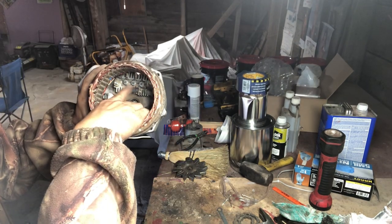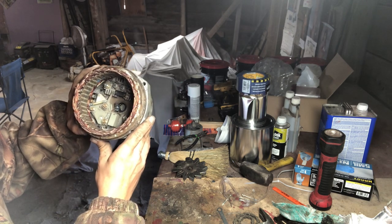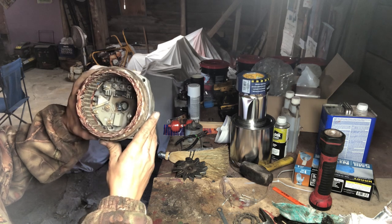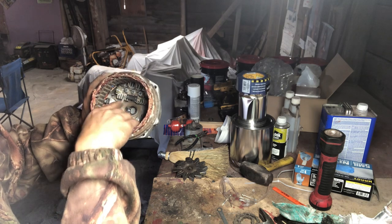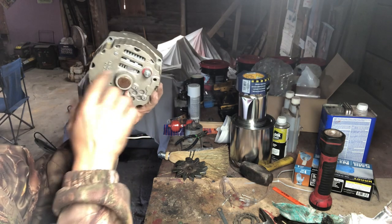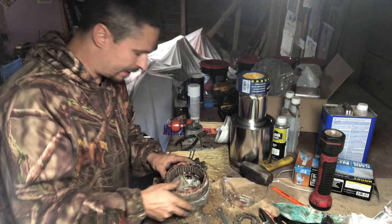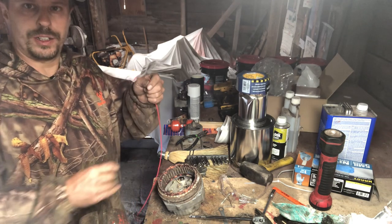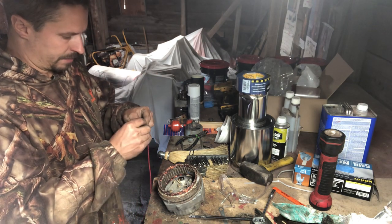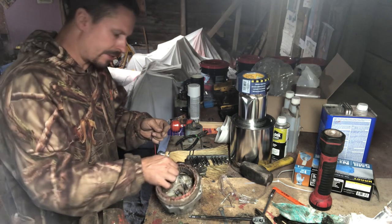If you look, you've got those three guys right there. All you've got to do to make this alternator charge your tachometer — pick whichever one you like the best, route it out through that hole, slam this whole thing together, and we're going to be in business. I've chosen today to go with some red wire to keep everything confusing, and it's the only color I've got in my toolbox, so it's going to have to work.